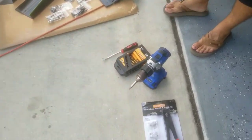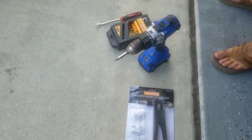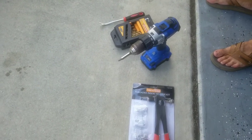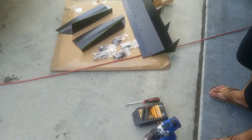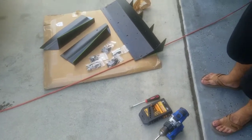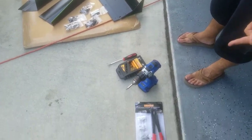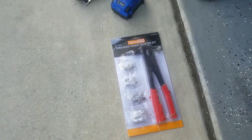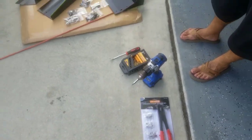Other tools you're going to need that don't come with the kit — it comes with all the hardware you'll need — but you're going to need a 5/32nd Allen head wrench, 7/16 socket, quarter inch drill bit, masking tape, and a pencil. You may need a rivnut tool; you can get that at Harbor Freight, they're like $21. That's if you get that center airfoil and your subframe isn't threaded.